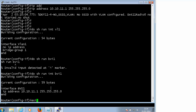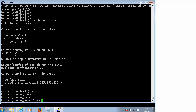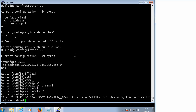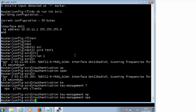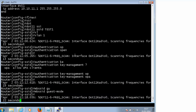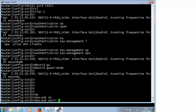Now what we have to do is create our SSID. This is something that allows you to put your passkey and all other options that you want to apply for this SSID. It's Test1, VLAN 1. We want to have it enabled. Our authentication is going to be WPA, and we need one more command to broadcast our SSID - that's the 'guest-mode' command. And the last one we need is our password.